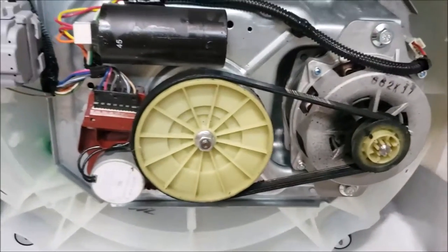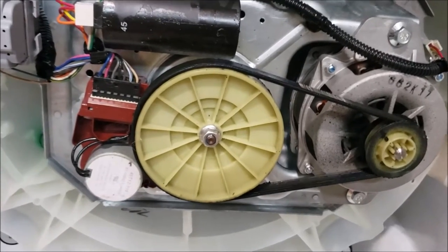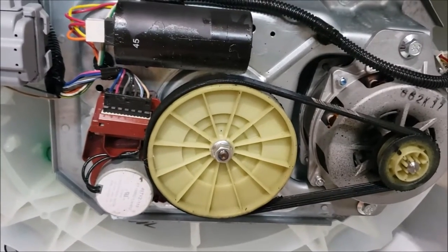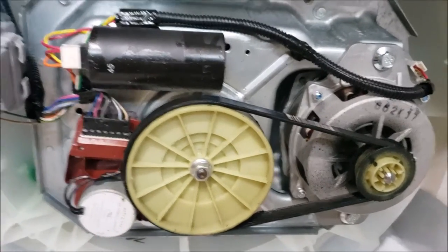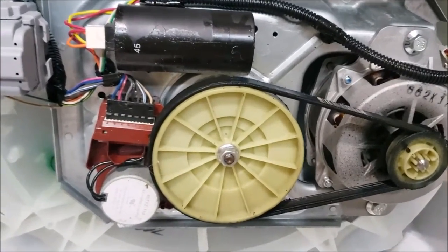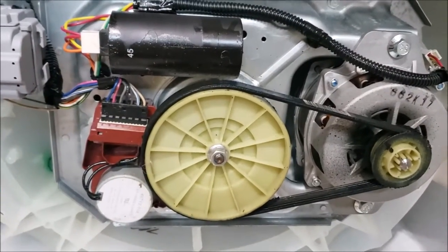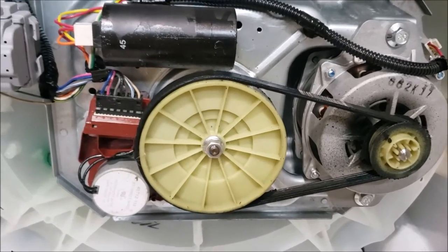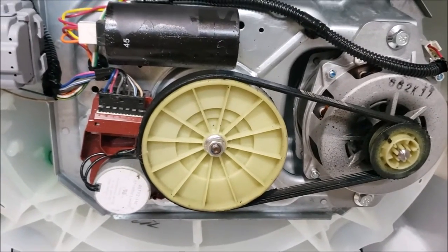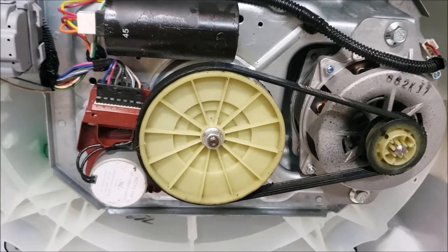The transmission is $170 to $200. But I found out in this particular design the little gearbox has a set of planetary gears in there — like a gear reduction. It's all plastic parts and it puts maybe two ounces of oil in there. There's a little oil seal, and I guess the seal eventually gets worn and begins to leak. Later models don't use oil — they use something like lithium grease, something easier on plastic parts.